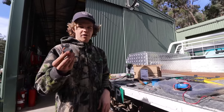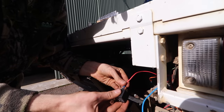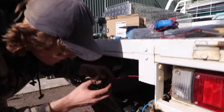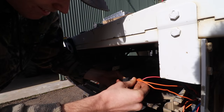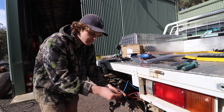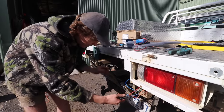So for us, our 30 pin, which is the bottom one, that's our main power source from the battery. So we're going to just plug that one onto there, like so. And then on the opposite end of that is our light positive. So if we get the positive to our lights, which is this one here, put that on there like so. For 86, we put on the power wire from the factory light, which is gonna act as our actuator, as our signal to then open the other circuit. So we're just gonna chuck that one on. And then finally, we have our ground for the lights.